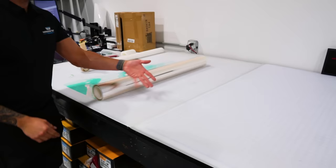And spray a little bit more soapy water to lubricate the window. That way our hands and the squeegees don't stick to it. Get an initial tack. Make our final adjustments. As you squeegee, it will still continue to move if you have enough soapy water in your bottle. So I like to get this initial tack done, position it perfectly in place, and then I'll go at it with the orange crush with the handle.